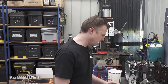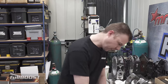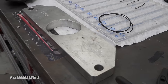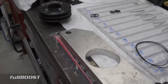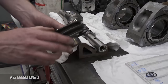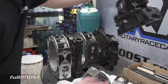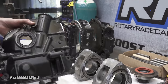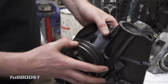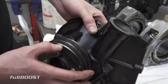One of the first things I do before I start building an engine is using this tool here, which is a top-dead-center setter check fixture from Extreme Rotaries. What it does is it locks the eccentric shaft in place on the front iron, then you can mount your pulley to the front and with the timing cover, there's a marking pointer for timing. With the shaft in and the engine mounted, this will spin around. I've already put a mark in there — that mark right there is actually true top-dead centre for this engine.